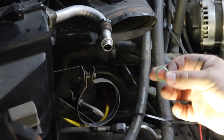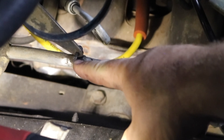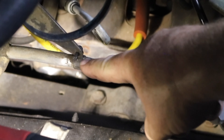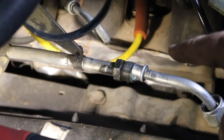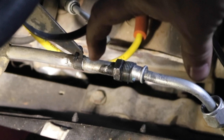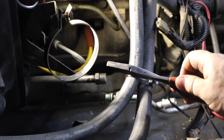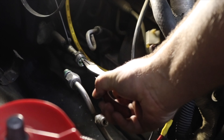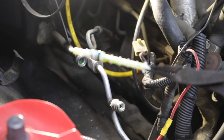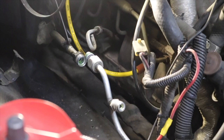We'll go ahead and take this O-ring off — all these O-rings are junk. This is where the orifice tube is. If you look right here, there's a little indention that stops your orifice tube from going too far in. It's on your high side, also held in on the other side by this tube, and that's what holds your orifice tube from moving around within the system — usually on the bottom of your evaporator core, at least in GM cars. Duck bill pliers are my absolute favorite for things like this. That orifice tube looks pretty clean — never reuse an orifice tube. They're like $1.50 or $3, just junk it.